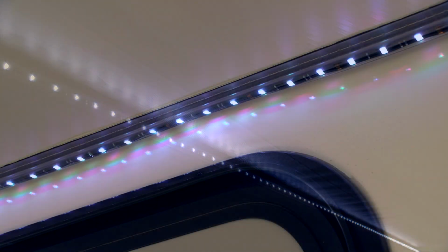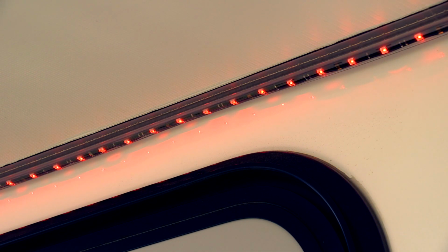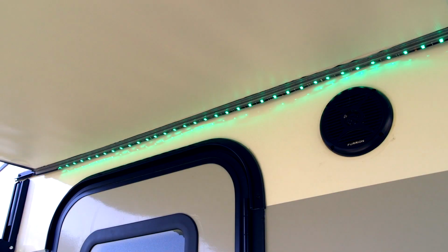Factory installed LEDs are located on the roller tube or can be mounted at the awning rail. To operate the white LED lights, you must have the LED power switch on. Select OEMs may offer RGB color LEDs. These lights use a separate IR infrared remote and sensor. The top of the remote must be pointed at the infrared sensor on the LED receiver module.